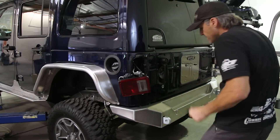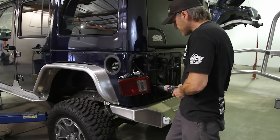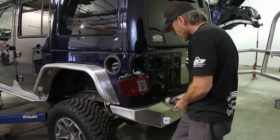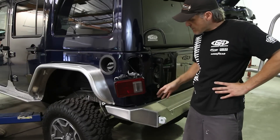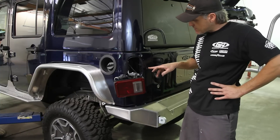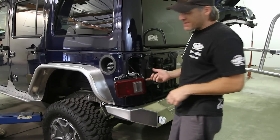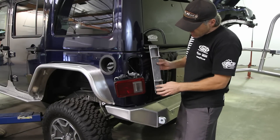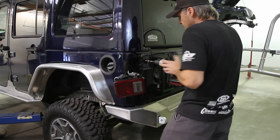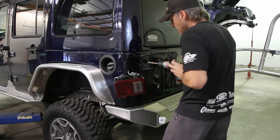All those are quarter-inch holes. There's an inner wall, so you need to drill through that second wall on all three of the bottom holes. The inner wall on pretty much all of these is accessed through the tail light hole. The two outer holes — which are inside where the tire carrier goes and will be for the bumper — need to get drilled out to 5/16 inch, going through both walls.